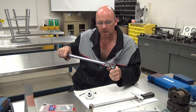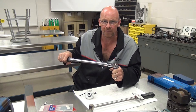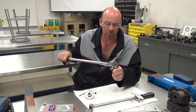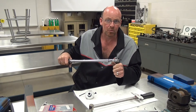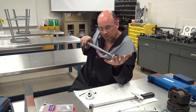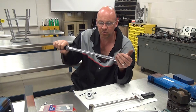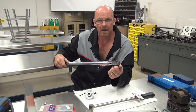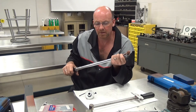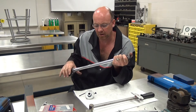When torquing is being done, we don't want to jerk up to that value. Sometimes values can be very high — three, four, five hundred foot-pounds of torque. If that's the case, you need to get your body in position or have somebody help hold the other end of the wrench. For example, doing U-bolts on a front axle, you need a technician to hold that socket in while you're under the truck on a creeper pulling to that torque. We want to pull it consistently until we hear the click on the torque wrench. A lot of technicians will double-click to confirm that the torque has been applied accurately.